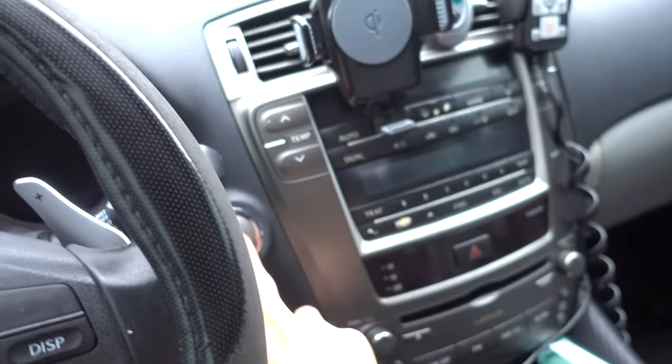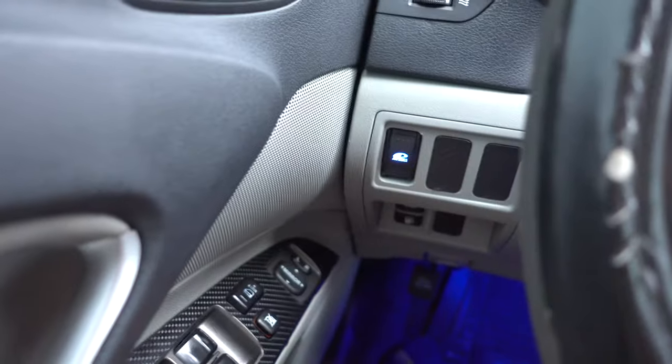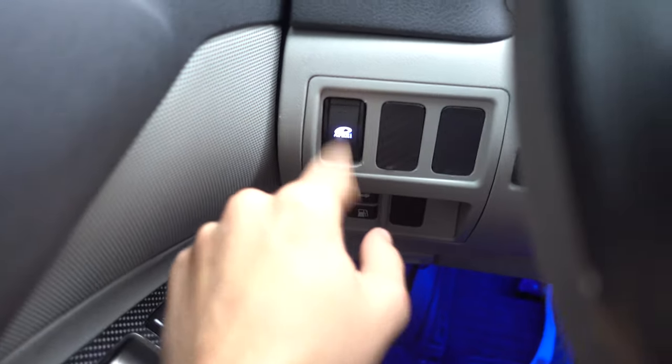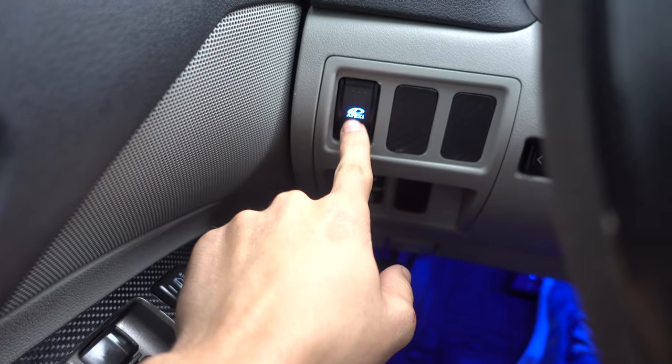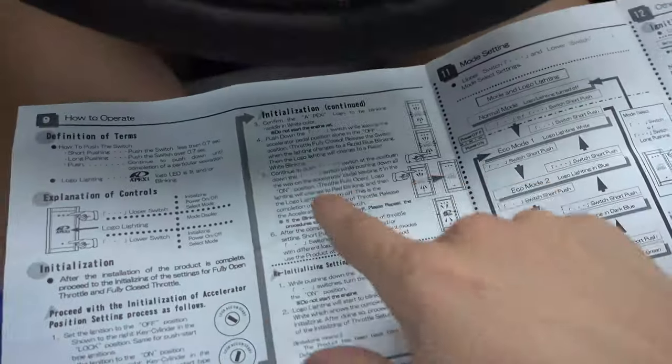Turn her on. There it goes. Yes, it is blinking for me too, not just for y'all. So it wasn't working, it was blinking. I had to read the instructions again, guys. You have to make sure it knows that it's connected to the gas and it's still getting that signal. So you just had to hold a button down, wait till it turns red, then hold a button down, press the gas while the car's off, and then it'll turn blue, or the other way around.